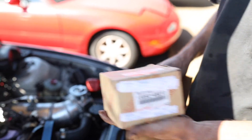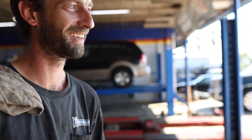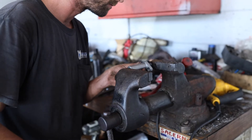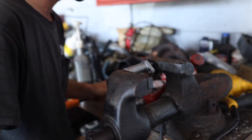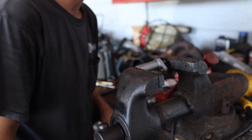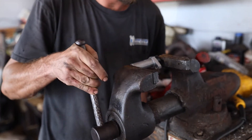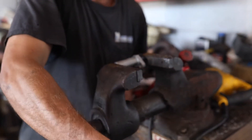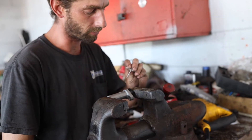Toyota. Dang, it's like brand new — it should be. So we're re-compressing the tensioner and re-pinning it, that way we can just slip it back in and pull the pin like a normal tensioner install. This one's pretty much brand new anyway, so we're not... normally you would replace it every time, or usually every time.